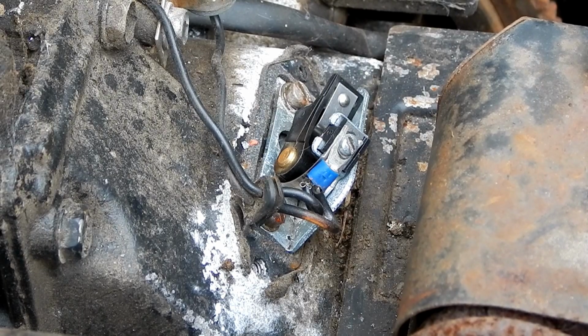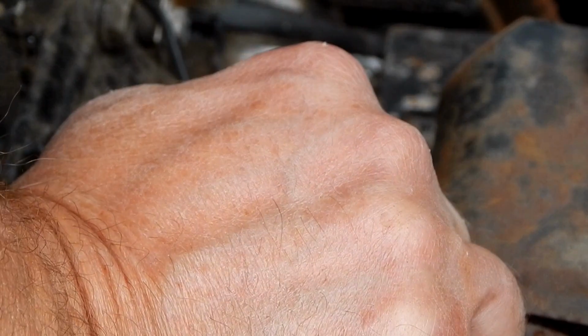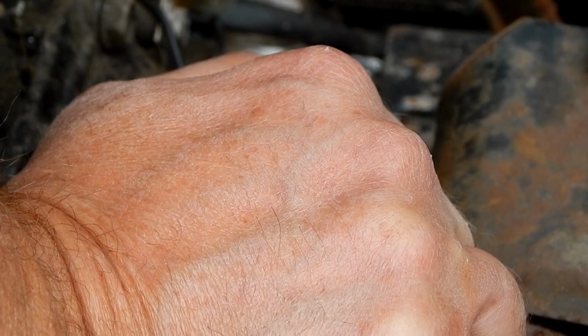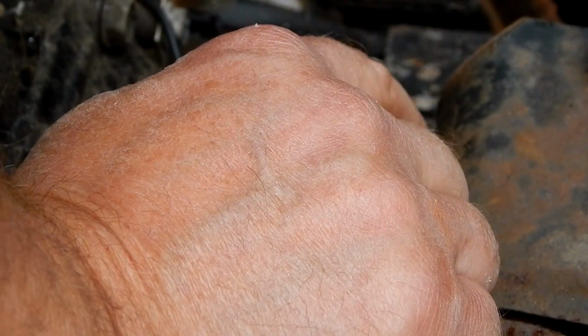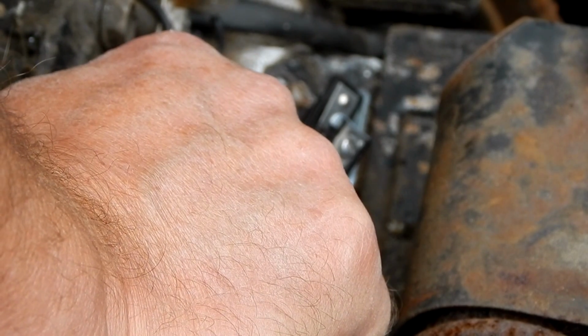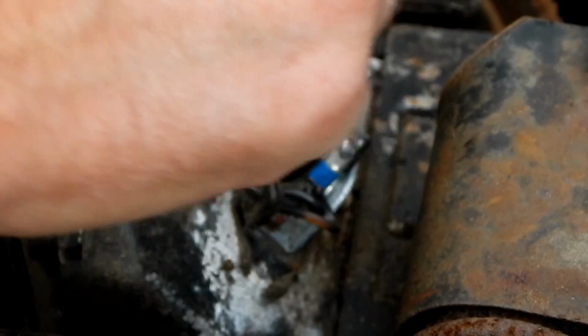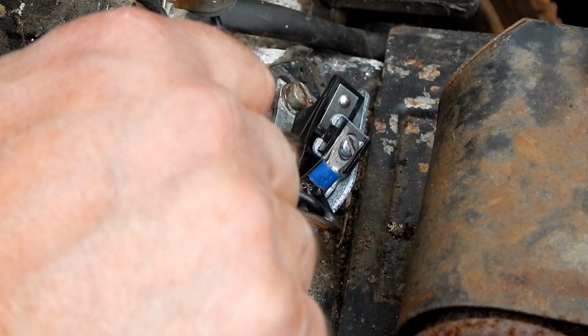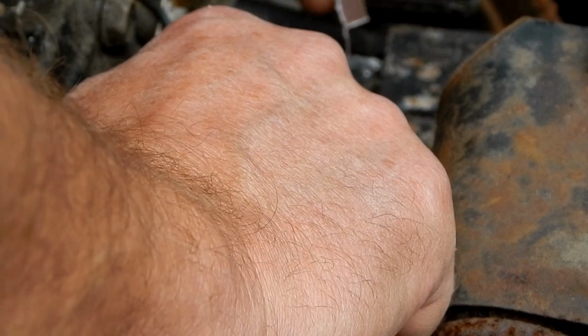This is the KT17. I think it was called the M18, so it's supposed to be like 18 horsepower. But one of the big improvements they did to that engine was they got rid of the points and added electronic ignition to it. This actually has the pistons and rings from the newer engine because they fit perfectly.